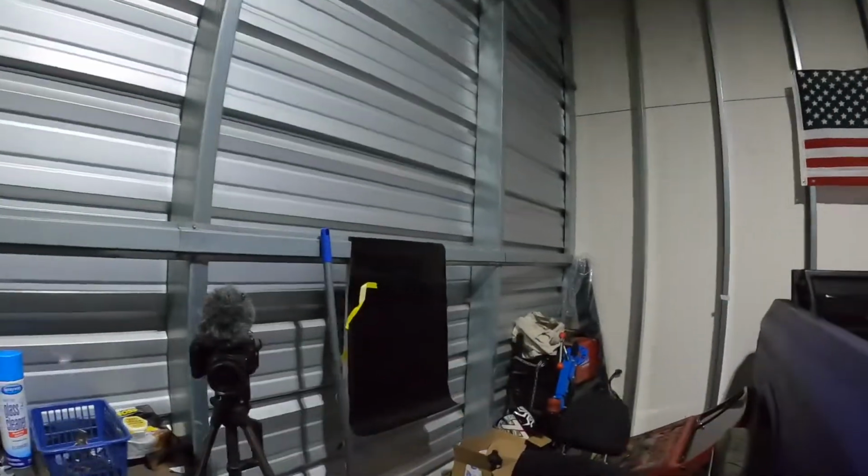Unfortunately, we don't have a tank for the new welder yet, so we'll probably have to use the flux core welder, unfortunately, to weld that in. We'll just have to make sure I clean up the welds and stuff, because the downside of the flux core is it does pop and leave a lot of leftover residue.